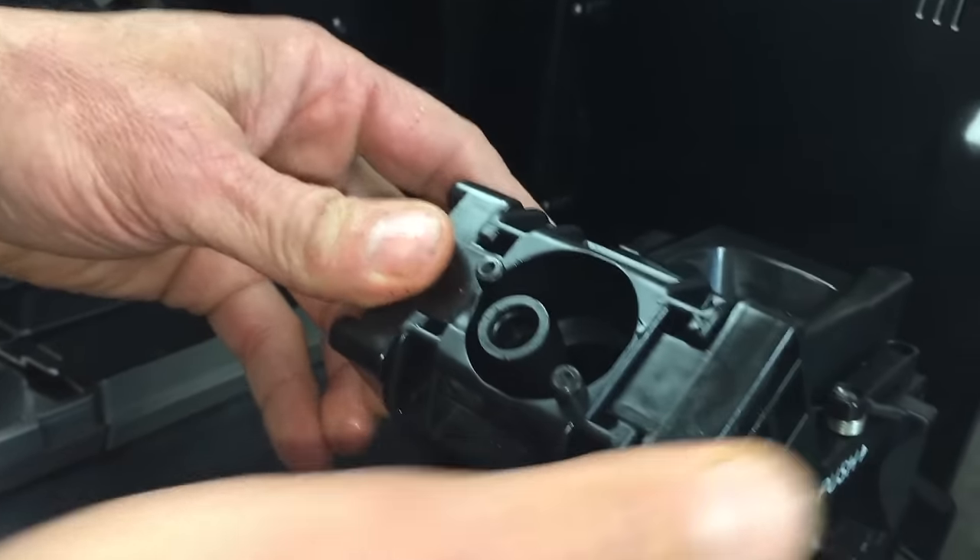I would probably make sure you let it dry first before you put it back in — if your ground coffee gets around it, it'll have more of a tendency to stick to it. That's one step above basic cleaning — that's a deep cleaning, not a total teardown, but you don't really need that all the time either. We used the Cafiza, and we also took a look at the Gaggia service kit that we have available.